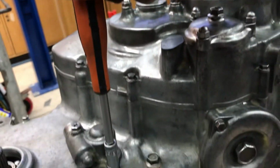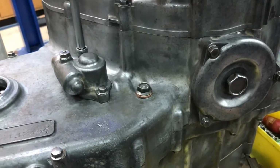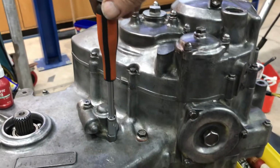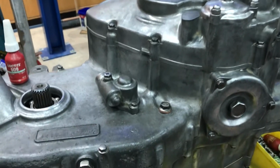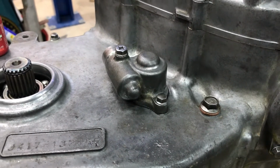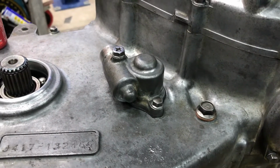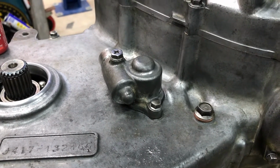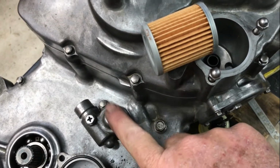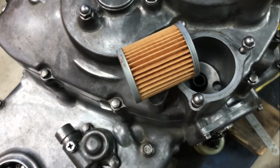And you know, I'm not applying much at all. You get a feel for 6mm screws in aluminium. We're all working on Suzukis made in Japan with metric kit, so yeah, the book probably has a torque. I think there's a general spec in the front of the book about 6mm bolts, and you know, we're talking, I don't even know what the number is, 4 foot-pounds or something. Odometer sender's bolted down, just medium Loctite on the threads.